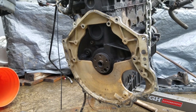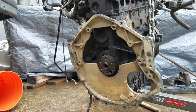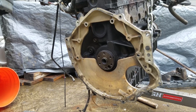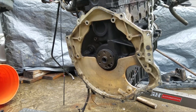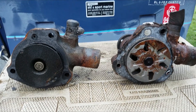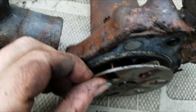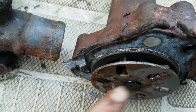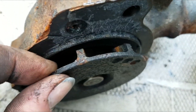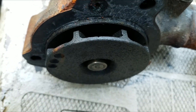This was the last piece of the puzzle — making sure that this plate was able to fit onto this engine means that this engine will be able to go in the boat. The water pumps are almost exactly the same until you actually look at the impellers. The one off of the truck is a lot less hardy and it's already starting to rust, so I wasn't going to use that one anyway. But the boat's water pump is cast — there's a lot more meat on there. It's definitely the route to go, so this is going to be the one I'm putting on the Ranger motor before I install it.